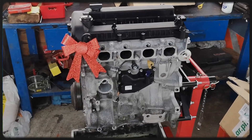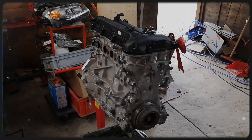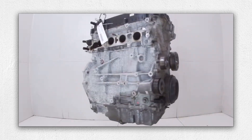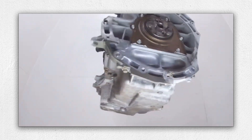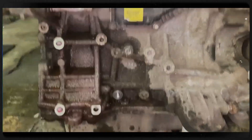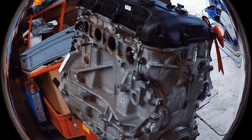This engine is considered one of the most trouble-free in Mazda's L series. With proper maintenance, many owners report exceeding 300,000 miles without major failures. A slightly louder engine note is common, especially at higher RPMs, and some drivers note that to accelerate quickly they must push the RPMs, which may lower city fuel economy. Owners occasionally mention coolant or oil leaks around the heat exchanger, and power steering pumps, alternators or other bolt-on parts can fail over time, typical for many aging engines.